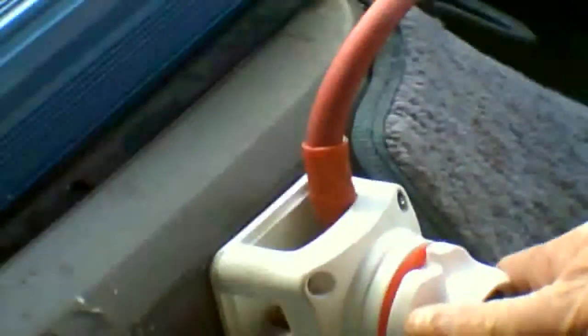Now it's pulling zero and it shows the battery at 14.2 volts. Let's go ahead and shut this down. Always make sure if you hook up an inverter like this you put a switch on it so you can shut it off. What I would normally do is - if I was driving, once my vehicle started I would go ahead and turn the switch on if I need to use it, but other than that I would leave it completely off so the battery itself on the vehicle charges.